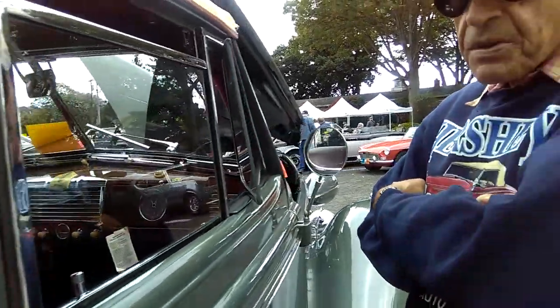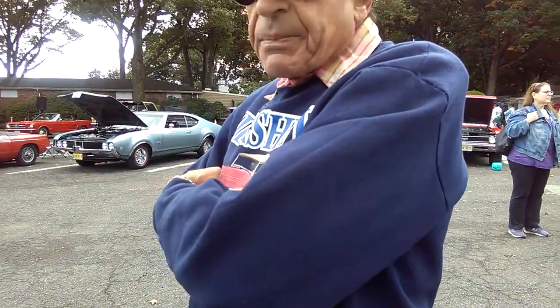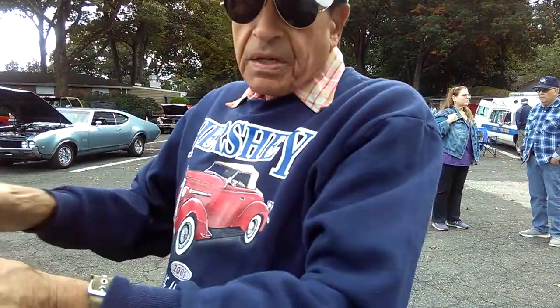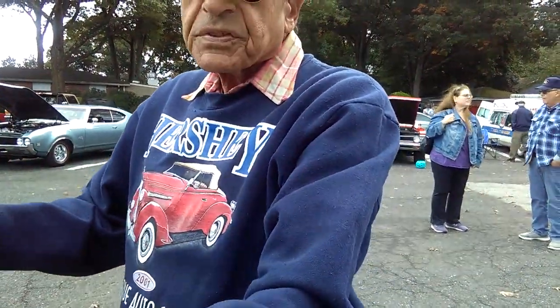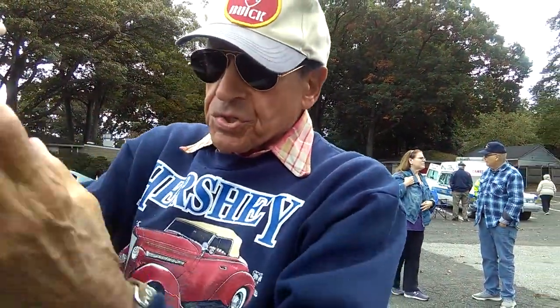They were testing Mercedes because they had the independent rear in 38, but it didn't go with the torque tube, because you have an enclosed drive shaft here. But the four-wheel coil suspension did. I have airplane shocks in this, the tube shocks, but apparently there was a stability problem, so they went back to the lever shocks in 39.